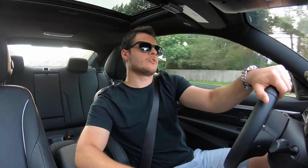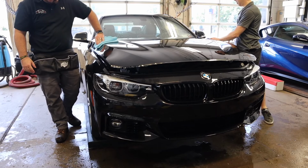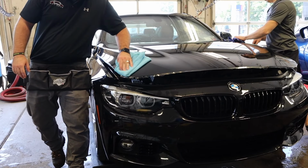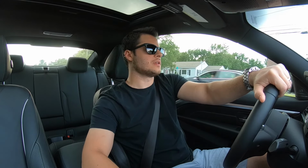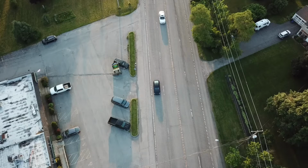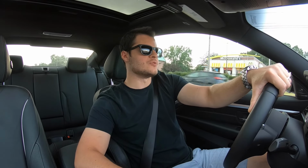After the PPF is applied, there may be some bubbles that remain for a little bit, but all of that should go away once the film basically fully dries and adheres to the car and everything. So I think all the bubbles are gone on my car. There were only a couple after the work was completed, and basically 3M says that you shouldn't pressure wash your car for a week after the work is done. Buffalo Car Care told me 2 weeks, so I definitely will not be doing any type of pressure washing for at least 2 weeks. I'm probably gonna go like the entire month of July, I think. So for the next couple of weeks, if I do end up washing this car, which I haven't been driving a lot, I'm just gonna hand wash it.